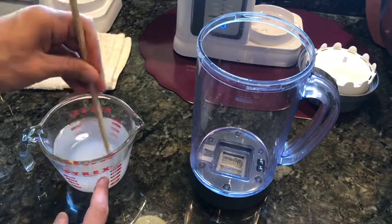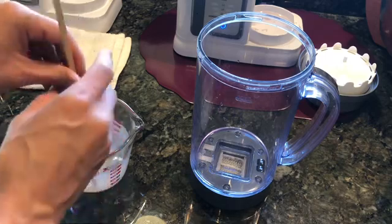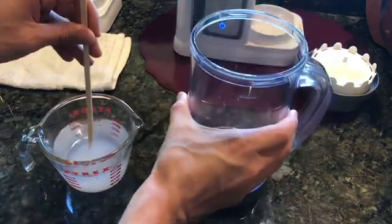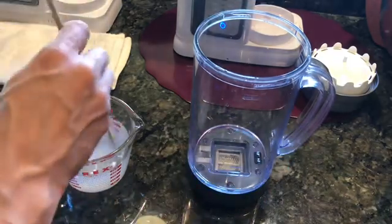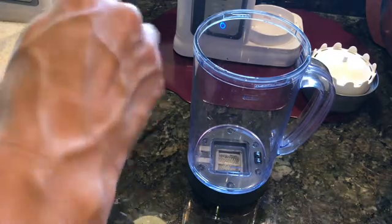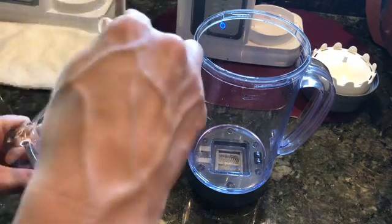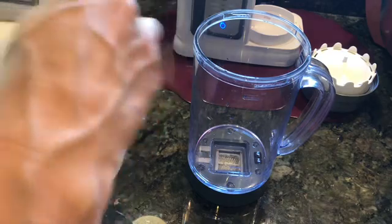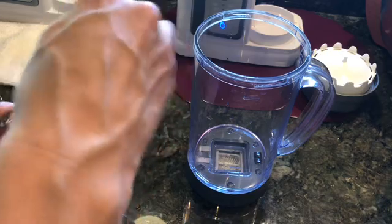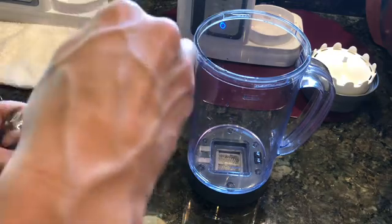For normal cleaning you use about 500 milliliters of water with five grams of citric acid, and it can just sit in there for about 30 minutes or maybe an hour. It's nice to swirl it around sometimes to loosen the stuff up. In this particular case we're doing a very deep cleaning because my buddy was not doing any cleanings, which is a really bad idea. It'll damage the unit and you don't get all the hydrogen that you should be getting. Even if it's distilled water, you really still need to stay on top of the maintenance in order for the unit to last a very long time.